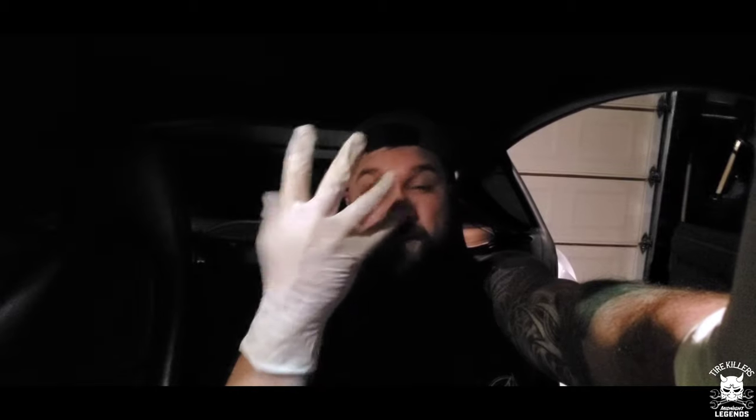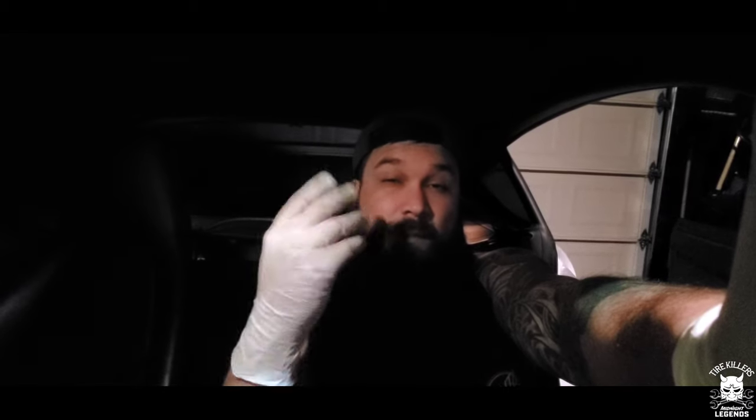All right, guys. Well, that's that. Didn't take that long. I mean, what? 15, 20 minutes, really, to just take off a headlight, take the bulb out, put a new bulb in. Make sure to wear gloves when you're putting them in because you don't want to put the oils from your fingers on the bulb, or else you're going to have to go buy another bulb. Eventually the bulb is just going to burn out because you have all that oil on there and it's just going to crack the bulb. But yeah, we basically did it in about 15, 20 minutes. Really easy, simple thing to do.